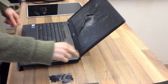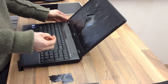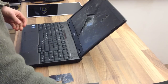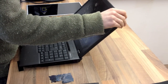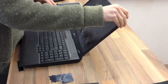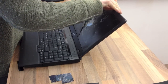We'll start off by removing the screws around the panel. These rubber grommets will just pull off with a fingernail or get a screwdriver under them. Try to keep them face-side up so the glue doesn't get ruined, which makes them easier to put back on. Usually they will go straight back on first time, but now and then you do have to re-glue them. My method for that is to use double-sided tape — you can get tissue-thick double-sided tape from eBay for nothing.